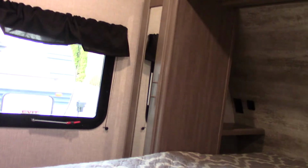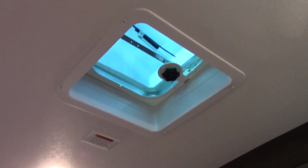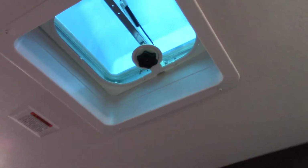Okay, you have a 50 amp system. Because of that, the sticker will tell you that this is pre-wired for a second air conditioner. That's why you have a 50 amp system. A lot of people like to add a second AC these days, especially if they spend a lot of time in the south. To add the second AC, the vent comes off, this garnish comes off, and the air conditioner sits right there. This one, you would not have 2 zones on your thermostat. This one you would use a ceiling assembly, which is the cover on the inside, with controls right on it. A 13.5 air conditioner, which is pretty typical, would turn this into an icebox if you wanted to. It would be nice and cool.